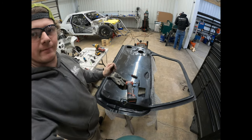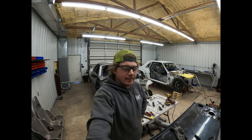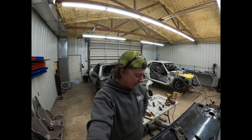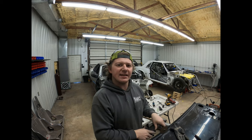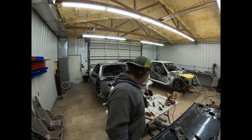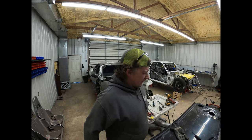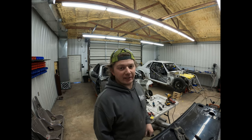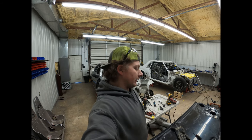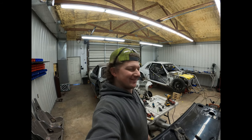Like that, it snaps into place, and just like that, snaps into place, works pretty good. So just a standard, I think it's a 048 cutoff wheel, around that thickness, don't quote me. But I just ground it out a little bit and it slides right on, just like it's supposed to. Just a little tip for you, so hopefully it makes things go a little smoother.